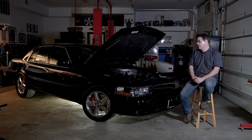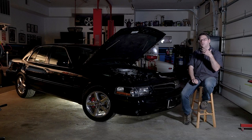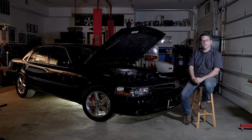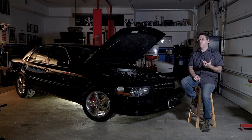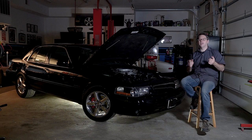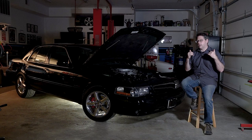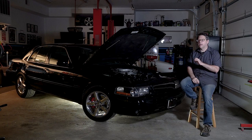I saw that and jumped to conclusions. Then after that oil change, I started driving the car and went to get it inspected. On the drive there, I pulled out onto the main road, gave it a little gas, it went into a little boost, and all of a sudden the car just fell flat on its face — no sounds of pre-detonation or anything. So I'm thinking: I saw this condensation, and now when you get on it and introduce a little boost, it's conking out. I'm envisioning a blown head gasket spraying some coolant into a cylinder. And the biggest thing we learned with these engines — especially from Lidio's post on the cracked pistons — is pre-detonation is just a disaster for these engines.